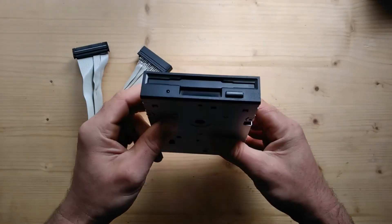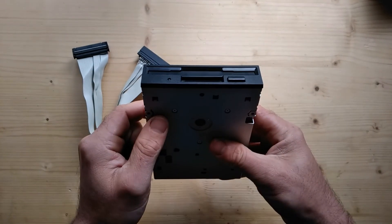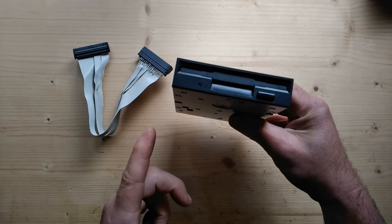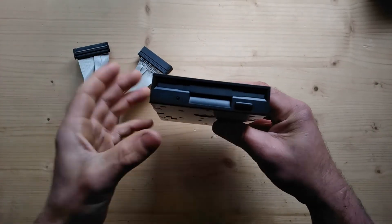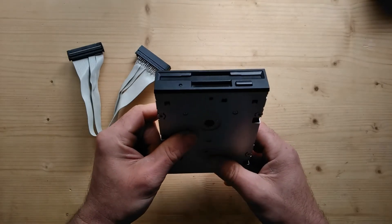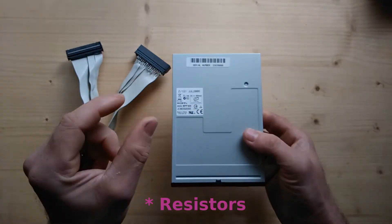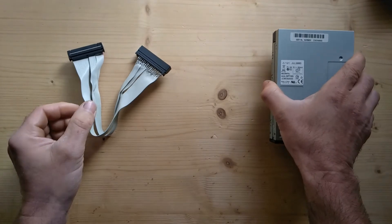There are two ways around this. The one I'd recommend is installing an ABBA switch — nothing to do with the 70s music group. It swaps your drives around so the external drive becomes drive A and the internal drive becomes drive B, allowing you to access files on your three and a half inch external drive as if it were the internal drive. The ABBA switch is a motherboard modification: you cut one track, join a couple of points with bodge wires, install two capacitors and a switch.